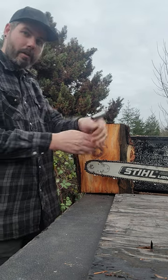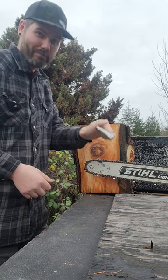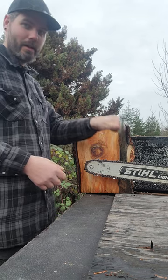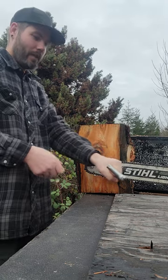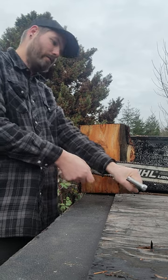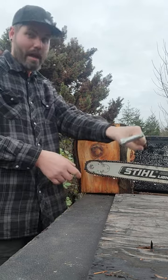You've got to be holding on — hooking that thumb. You don't want to be doing a thumbs-over grip, which I see a lot of people doing. You catch me with my thumb on top of the bar sometimes because I'm pressing, but it's still not the best. You want to be hooked. If you're in a position where there's a real likely chance of a kickback, you wrap that thumb.